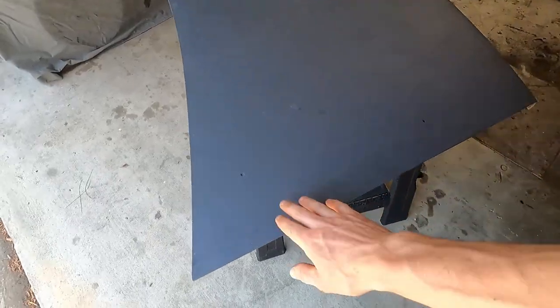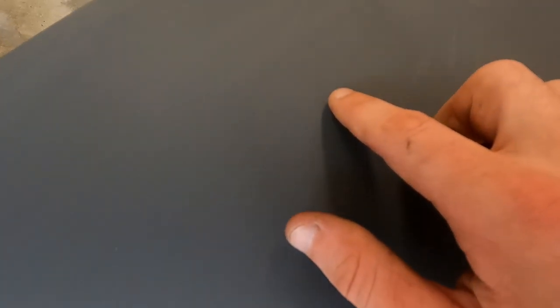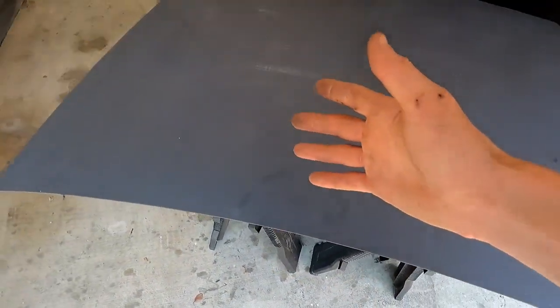As we make our way to the bench, I'm gonna show you these little holes here. There's one here for where that luggage rack was mounted originally. And you can see where someone before didn't fill it super well. So we'll go back through and fill those up a little bit. On this one, you can actually see a little bit of daylight through it. Maybe not on camera, but there you go. Now you can see some daylight. So we definitely need to fill that because we don't want any leaks, stuff like this along the edge that's rough. Like I said, not looking for perfect, but a lot better than this.